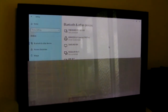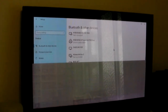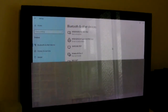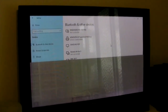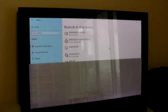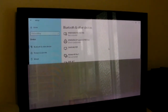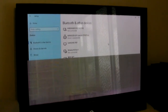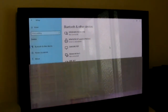Most likely it's a bad connector, like the cable has worked out or got dirty somewhere. So it's either where the cable enters the board or where the cable connector enters the board in question. So the next thing to figure out is which board we are talking about. But I think it's probably just a good idea to take the back off this thing, take every cable out, use a solvent to clean it, and then reseat it, put the TV back together, and then see what results we get from just doing something as simple as that. So that's what we're probably going to be doing next.